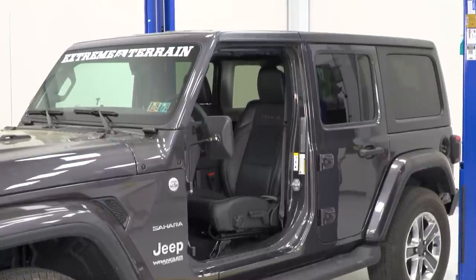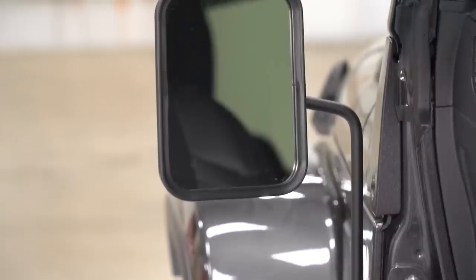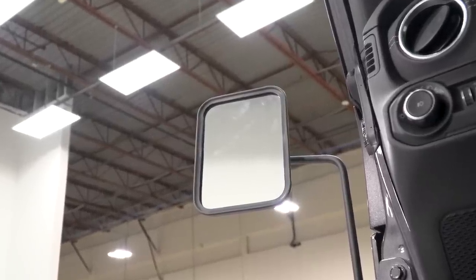This option is going to be similar to that, however you don't have a bracket that lives on the A-pillar. These just drop right into that top door hinge when the door is removed. Take the door off, put the mirror on, take the mirror off to put the door back on — so it's a two-step process. As long as you're okay doing those two steps, this is a very clean way to go about having a mirror when the doors are off. You still have your factory mirror in the factory location, you have your heat and your power if you have those options. Everything stays factory when the doors are on, and when the doors are off you have a very useful mirror as long as you're okay with that second step.